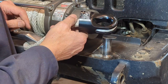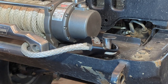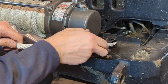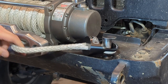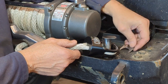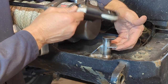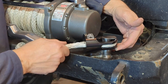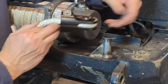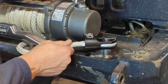I got it all burned in but I discovered something. The whole point of this dock is so you don't have to touch it and keep your hands out of the way — which is safer. But when I go to winch in, the thimble doesn't want to slide right up into place, and the last thing I want is to hold it while winching because then your fingers are in a danger zone. So what I did was make this little tab — I'm going to weld it right there. When I go to put the thimble on, it will lock right into the tab, then I tighten it and it will tighten straight.